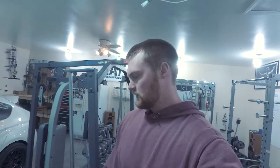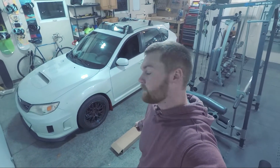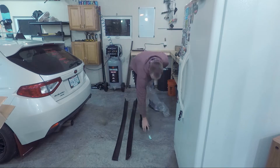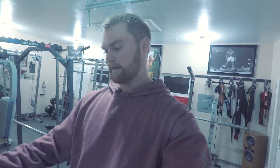So today we are going to be installing what's in that box — side skirts for the Subaru that I got off Amazon, $150 for both of them. They're not the most expensive and I'm sure they're not going to be perfectly straight. First off, I am going to start by cleaning the side skirts that are already on the car because we don't want to trap dirt between the side skirt extensions and the OEM side skirts.